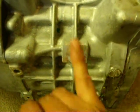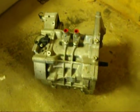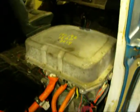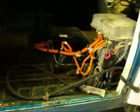Maybe they sense the resolvers, rotate them, and then stamp the numbers on the side — and that number has to be programmed into the inverter to make it run right. So I fluked out — I ran the wrong motor with the wrong inverter and it was working — but now that I have the right motor and inverter matched, it's definitely running better and smoother. I think the hole shot will probably be better too. Thank you Resolve EV for straightening out another issue I had and didn't even know I had. I was happy with it before, and now it's even better.